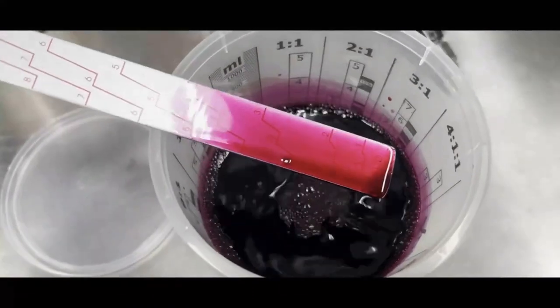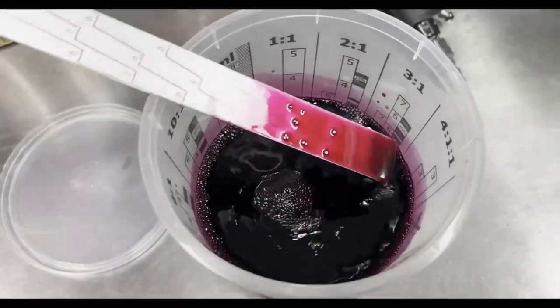So, in a nutshell, guys, I cut a lot of corners. I wanted to do my own version of the grind pattern and put a candy on it because I've never done it before. I actually put in the video that if you guys know how to do it correctly, to write it in the comments so I learn and everyone else learns. Well, no one actually wrote in the comments because a lot of people haven't actually seen this being done before. So cutting a long story short, I basically ground down the panel. I put Port Red candy over the top. From memory, I think I've done about 6 coats of candy. Then I used the DNA Paints Custom Clear over the top. I think I put 2 or 3 coats on from memory.